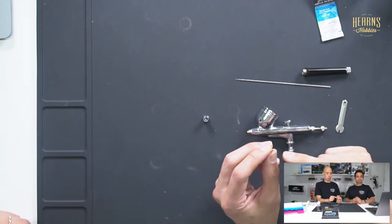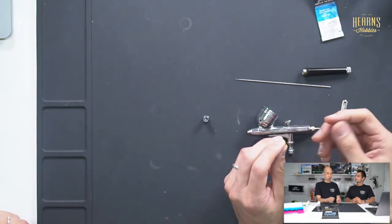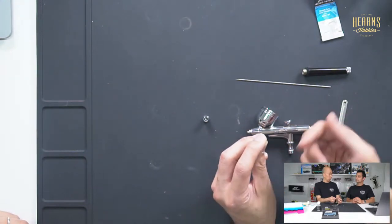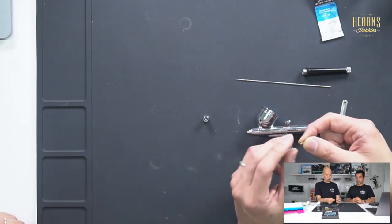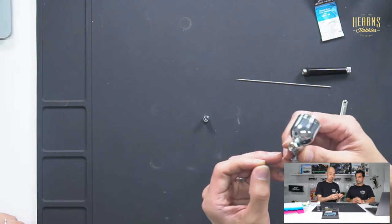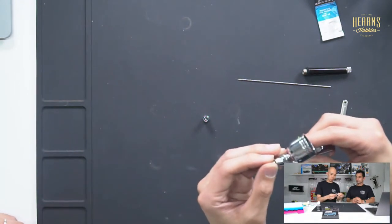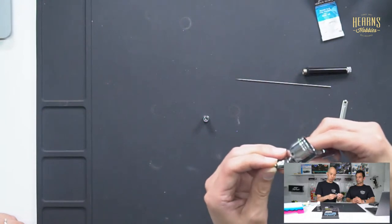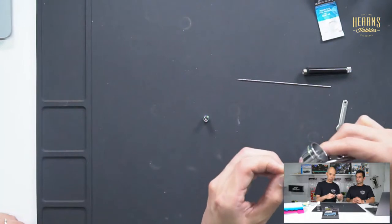And so it's very important that you clean it out, because if it doesn't clean out, it'll get blocked. It will get to a point where you see bubbling coming back up the cup, and that's usually because this section here has been blocked. That's right. Yeah. And then after it's all cleaned up, now to put it back into place, you need to spend quite a bit of time and be careful in screwing this on, because you don't want to cross thread it. If the threads go in the wrong angle, then they'll get damaged and they won't be sealed.